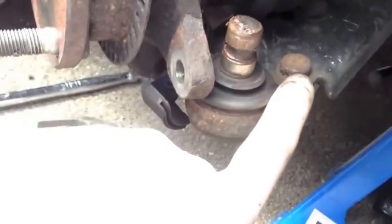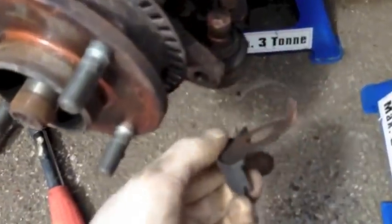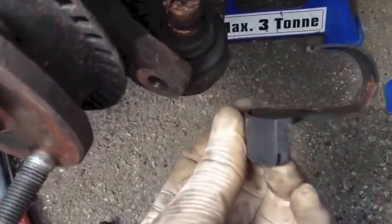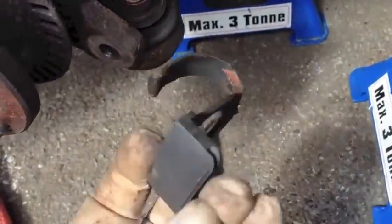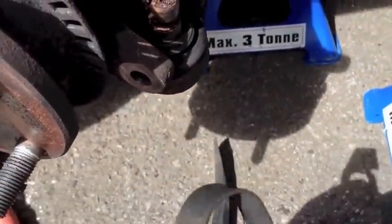Replacing just the ball joint is quite difficult, as this is riveted on. Unless you want to get an angle grinder and punch this out, it may be easier to just spend £40 and replace the whole lower arm — ideally, you don't want to be splitting that boot. When you take the lower ball joint out, there'll be a little plastic piece in here which sits over the end of the ball joint and protects the brake disc from any grease that might come out of the seal if it were to rupture. Sometimes these are metal; this one's like a plastic-y rubber. So that needs to go back on — just put that aside for the time being.